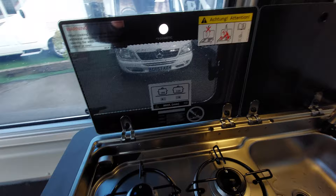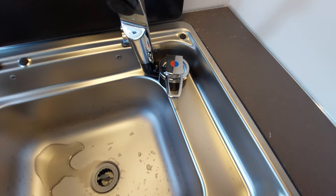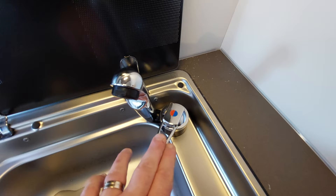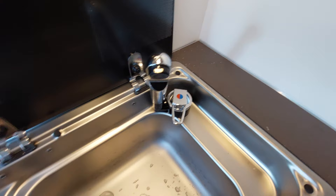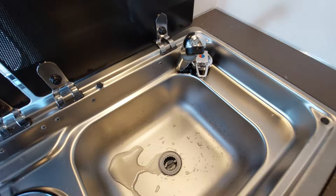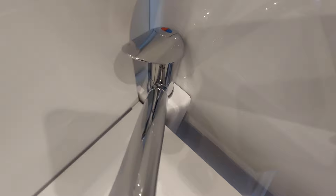The sink in the kitchen area is clearly marked on the top, hot or cold. Once you've come to the van, put your power on, filled up the water, and closed all the drain valves, turn it to hot and then lift that on. You'll hear the pump start. Don't leave that too long if you've no water in because you'll burn the pump out — what you want to do is pull all the air through the boiler. It'll spit and spurt initially; run it until you get a steady stream. I'd advise you to do that both in the kitchen area and in the bathroom area. The bathroom tap, which doubles up as a tap and a shower, is clearly marked on the top for hot or cold.